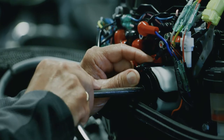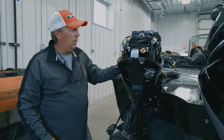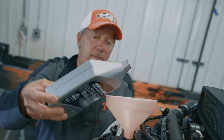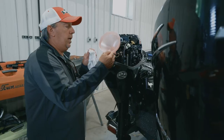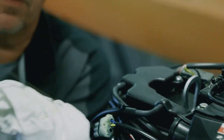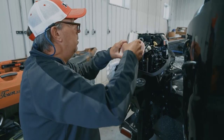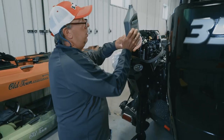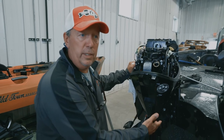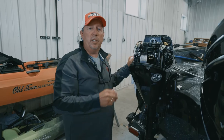After you put the oil filter in and seated the drain plug, it's time to add the oil. On this particular motor, we're going to add 1.1 quarts. Check the dipstick before finishing the top-off — we just need a little bit more. When you do start your motor, run it for five minutes, check the oil filter for leaks, check the drain plug for leaks, check the dipstick to confirm you're at max capacity in the oil reservoir, and you'll be good to go.